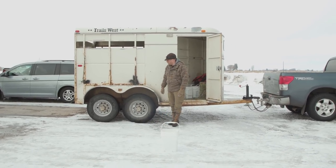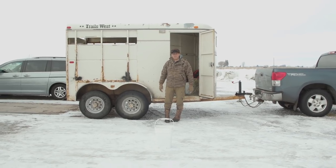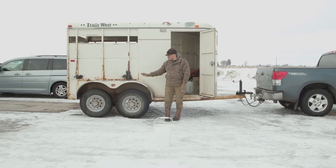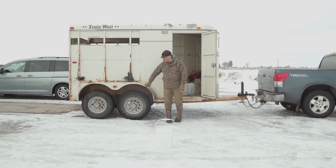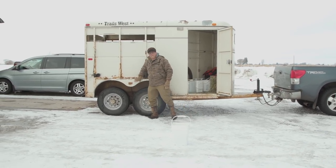Also consider the distance between the tires. When you get bigger tires, the circumference gets bigger and they'll start getting closer together, making it really easy for smaller rocks to get wedged in that space - and that's a really scary spot to be in. So when doing custom work on a trailer, watch out for spacing between your axle, your tires, and your fender.